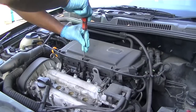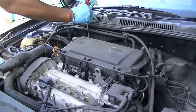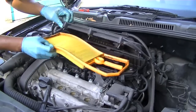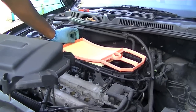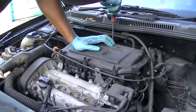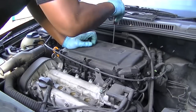The air filter is very simple. All you need is a Phillips screwdriver and about six or seven screws. Once you remove those screws you gain access to the inside of the filter housing — the filter just lifts completely off. When putting in the new filter, make sure it's seated properly with a complete seal. Fumble around and feel it's right, and then it'll work properly. Screw it back on, tighten it up, and check the seal to make sure it isn't being pinched.